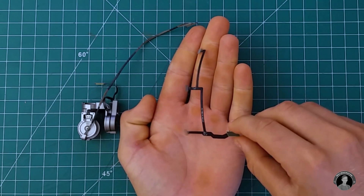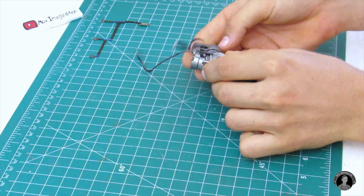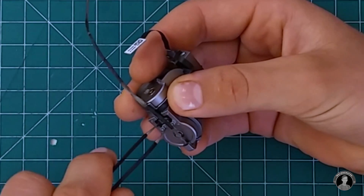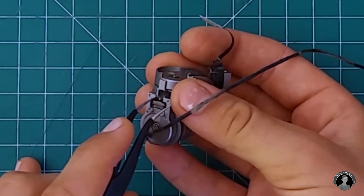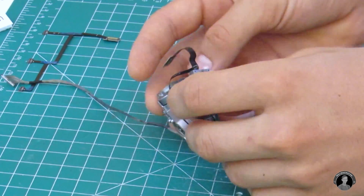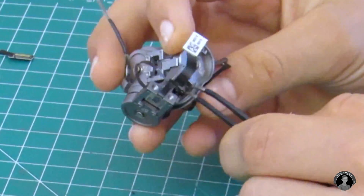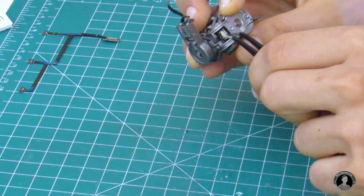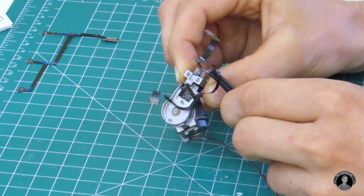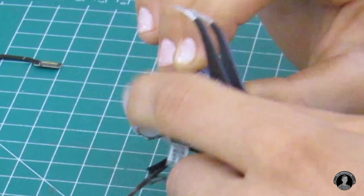Here we have the new gimbal motor flex cable. One by one as we're installing it, we're going to need to remove these little blue strips of tape, which reveal all the sticky parts. First, remove the old gimbal flex cable by starting out with the very last motor and working your way out, disconnecting each connector one by one in their order — first the roll motor connector, then the yaw motor connector, and last the pitch motor connector. Before unclipping each connector, be sure to remove any black silicon that may be in the way. If your gimbal appears to use any little pieces of tape, be sure to keep those.